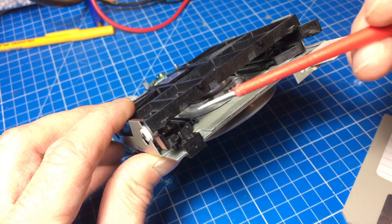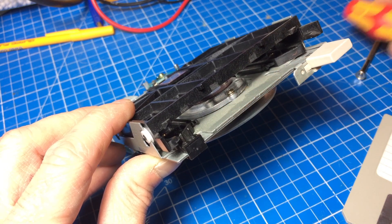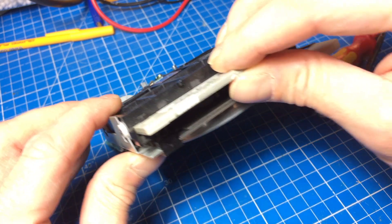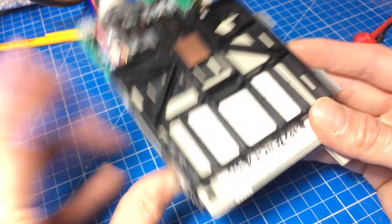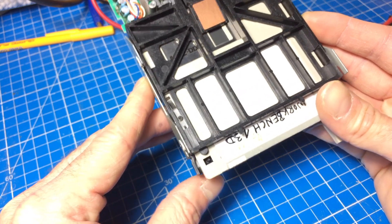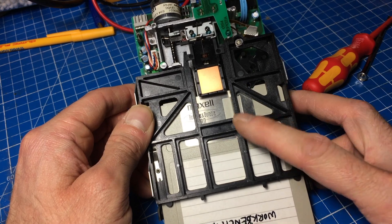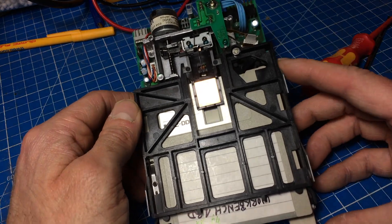What we have here, these little things, are little switches that determine if there's a disc inside and if it's write-protected. They basically clip into this little window here. You can see that one clipped in there, and the other one determines if there's a disc inside, so it doesn't hurt to clean those. Here's how the window to the data opens — it's quite a nice, smooth mechanism.